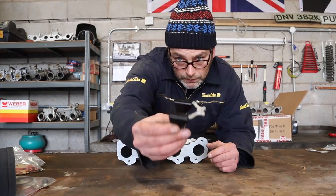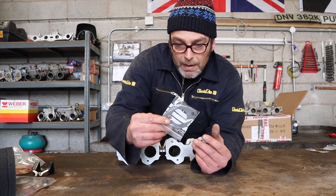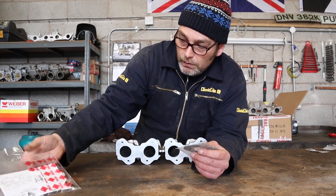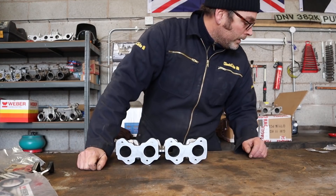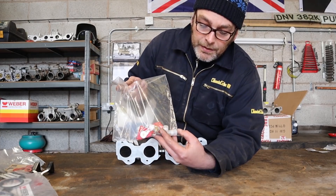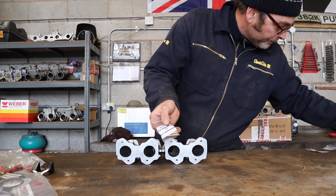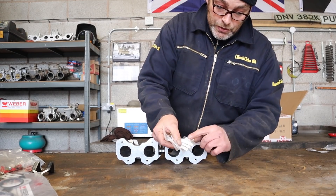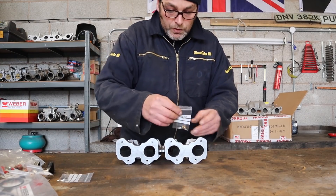Also got a new fuel float, and gaskets for mounting carburetors onto the intake manifold. You've also got the pump diaphragms, fuel filters, internal fuel filters, and the needle valve assemblies — so you're doing a full rebuild on your carburetors. You've got some emulsion tubes, some starter jets, some air corrector jets, a throttle valve screw, an additional internal fuel filter, a bore bearing for a spindle, and some main jets as well.